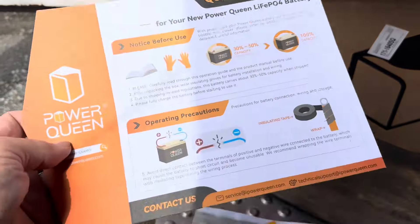Both battery terminals are M8 by 1.25, which is pretty standard for most lithium batteries nowadays. The battery stands 8.5 inches tall, 8.2 inches wide, and 21 inches in length — a very compact size given that it has capacity probably well over the two batteries currently in there. It will take up less space and have more storage capacity.